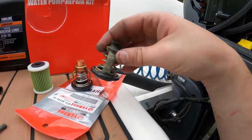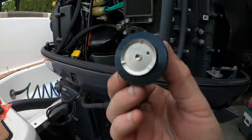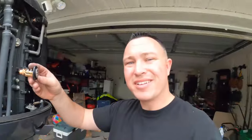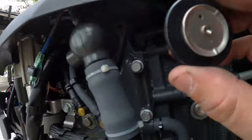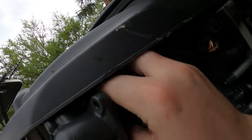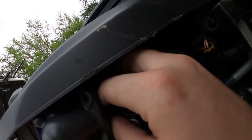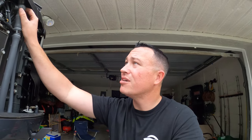There's really no proper way to put this on, but I'm going to show you the difference between the new one and the old one. Here's the old one and here is the new one. Even though there's no single proper orientation, when I take it out I try to see where this little hole is and where it came out, and then I just match it. Then go ahead and put some anti-seize on the three bolts, put them back in, and you've changed out your thermostat.